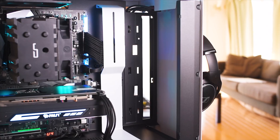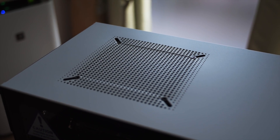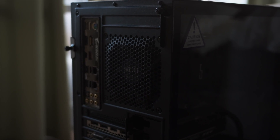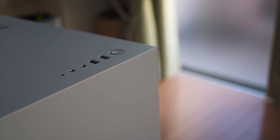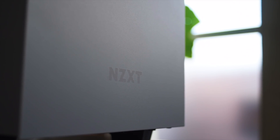The results show pretty much no change between using no fans, static pressure fans, or airflow fans in the front of a case. I think this is because the exhaust fans sucking out hot air create convection that pulls air in through the intake to replace it, and this natural convection already saturates the bottleneck that is the gap in the front panel — which is why adding extra fans doesn't seem to make any difference.